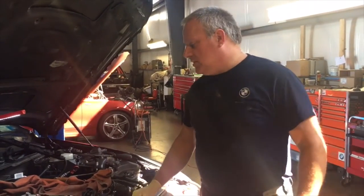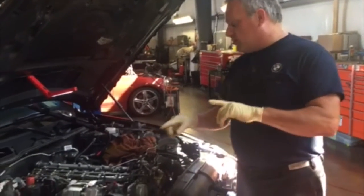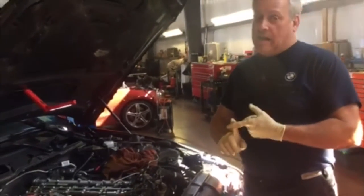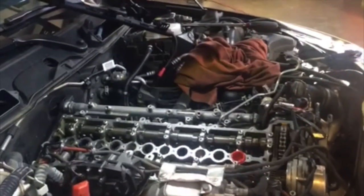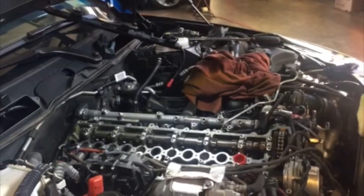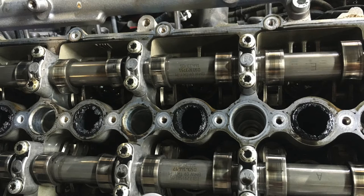One of the problems we experience with these cars is that they will carbon up like nothing you've ever seen before. This vehicle has two actual separate sets of valves for intake air, and the problem is you get just air through the ports, because the diesel fuel is directly injected — no fuel actually going through the ports where the air goes. On top of that, the turbo needs to be lubricated, so they squirt oil into the turbo. The turbo shoots it up into the intercooler and then into the engine through the ports — again with no fuel — and they carbon up very, very badly.